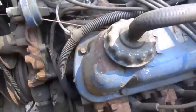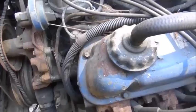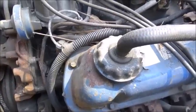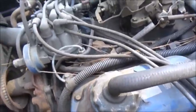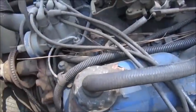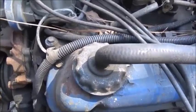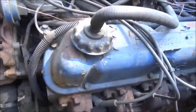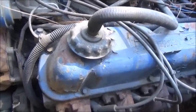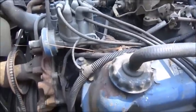The engine wiring is going to be different because this is a later model engine. I haven't looked at the numbers on it yet but I'm pretty sure this is going to be a 351 Windsor. They've got a mechanical temperature gauge and mechanical oil gauge in this thing, so we don't have to worry about wires for gauges. I'm not going to worry about getting everything working on the dash - it's actually a whole lot better to have aftermarket gauges anyway.